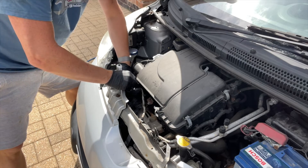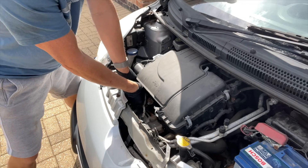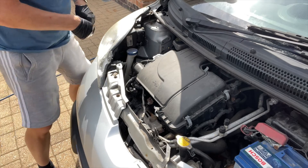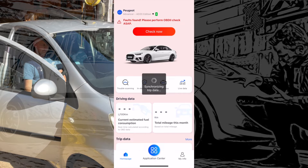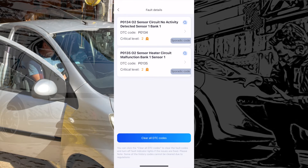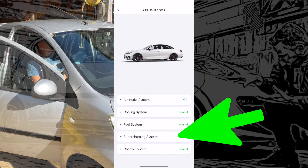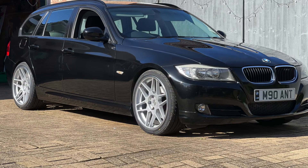Let's drop a little fault in — at the front here we've got the top exhaust oxygen sensor. We'll just disconnect that. We've pulled the plug — that should now throw a fault. Fire it up and straight away it's gone red saying there's a fault. Running the quick check: two faults found, both related to the oxygen sensor we disconnected. Now let's clear the fault — we'll use the DTC option at the bottom — reconnect it, and as you can see everything's cleared and done the job.